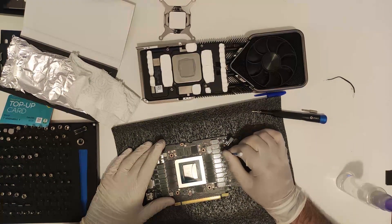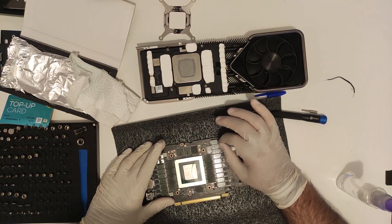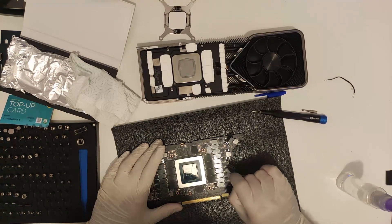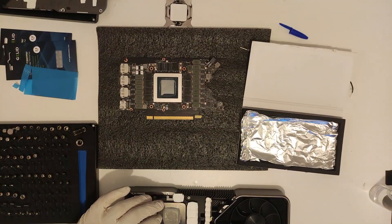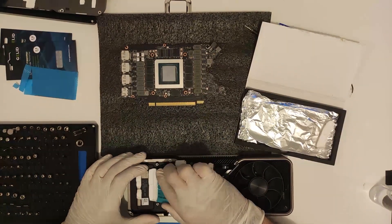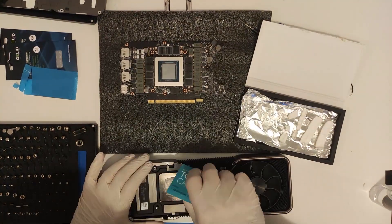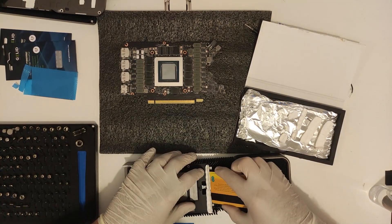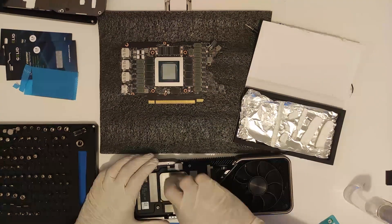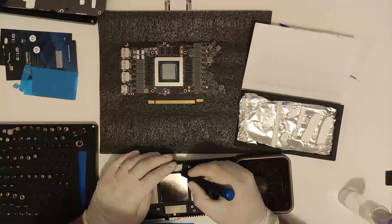This has been confirmed to void the warranty, at least in Europe, if you tell them or if they find out. That is also the perfect segue to removing and preserving the stock thermal pads in case you ever need to put the card back to stock. Try to use an old plastic card to go underneath and essentially scrape the pad off the cooler and gently deposit them somewhere safe. Obviously you won't be able to do this with the thermal paste, but Arctic MX-4 is a close enough match — maybe not in consistency but definitely in color. I used MX-5 in the reassembly, safe in the knowledge that it is soluble in isopropyl so it is easy to remove if required. After all thermal pads and paste are off the cooler, make sure you again clean everything thoroughly with alcohol — it is just as important as cleaning the card itself.